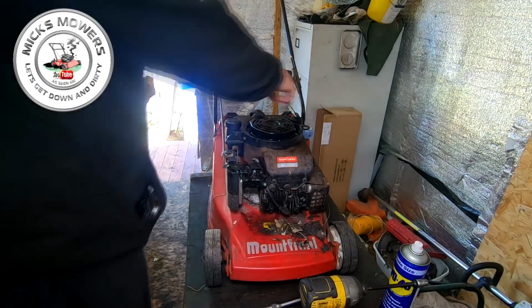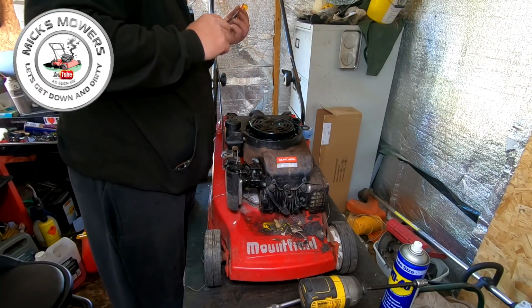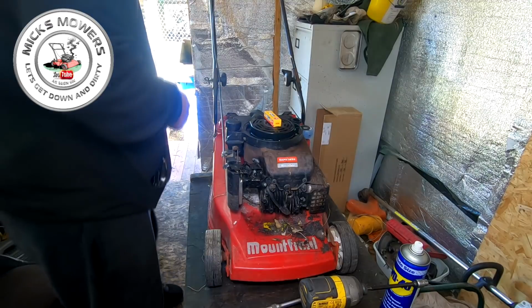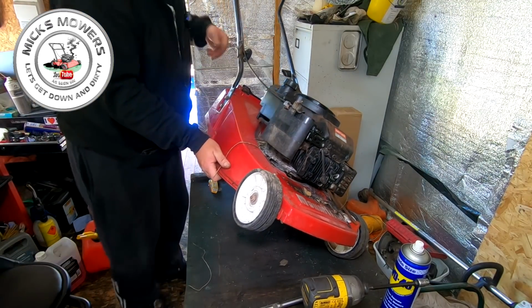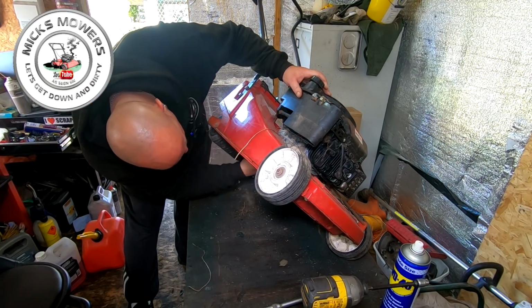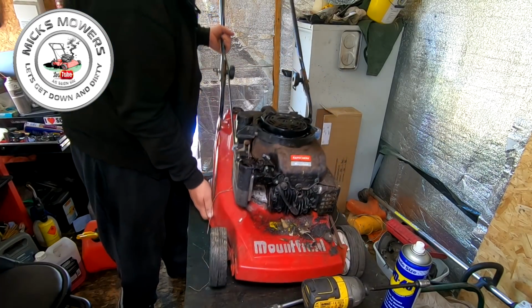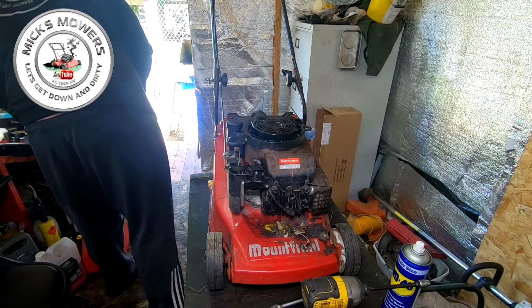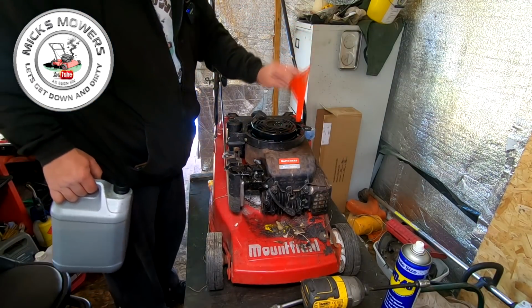Okay, I'm going to check the oil whilst we're up on top. Next to no oil at all, which is a little bit frightening because it should have oil in it. Let me tip it up and just check the oil crank seal. There's a little bit of stuff there, but I don't think it is. It's hard to tell with no oil in the machine. We might have bought a lemon. But we shall see. So let's put some oil in it first before we go too far.